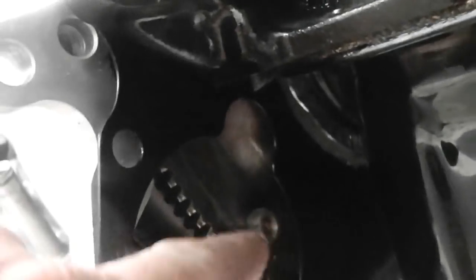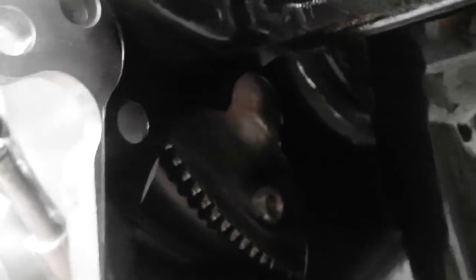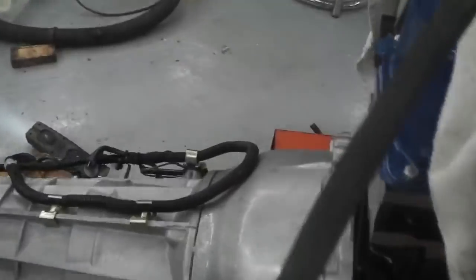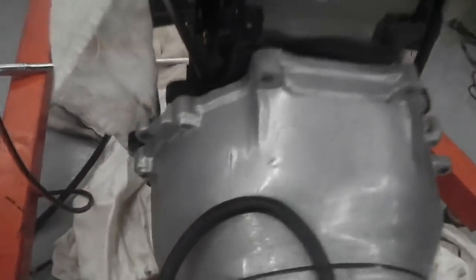Okay, we offer it up so that the torque converter bolts line up with the flex plate holes, and we just have to wiggle and jiggle a little bit, a little bit sideways, a one-two buckle my shoe, and you'll feel that gearbox into place. Keeping your eye on the sandwich plate as well, making sure it stays on, and then just wiggle in, which we've done.